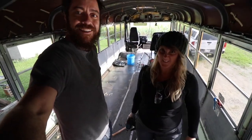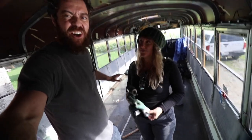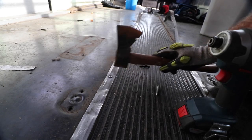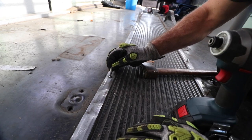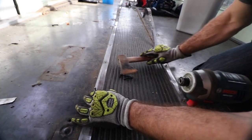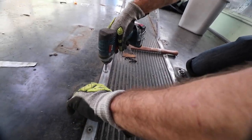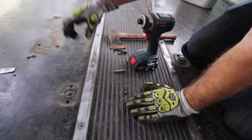These screw holes are crazy dirty. We're moving to the floor now - we wanted to get our hands dirty first before reporting back. You pound the top of the screw head just a little bit to loosen up the dirt, then grab your bit, place it where the square would normally seat, hold onto it, and tap it in. Tap it in a couple times, then put your drill back on it and back it out. Lift the strip gently - and that's how you do it.